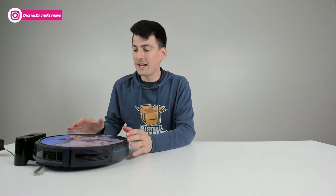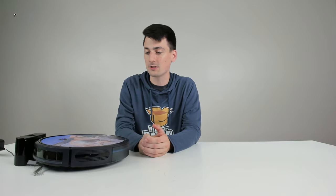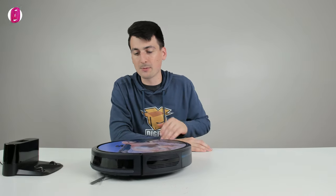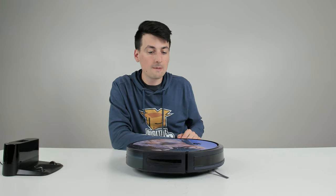When connecting to Alexa, you'll use the Smart Life skill to set everything up. If you authorize Smart Life and enter your credentials but it doesn't sync, go back and add it directly in the Smart Life app — that should solve any issues. Voice commands are simple: tell the vacuum to turn on or turn off. Hey Alexa, turn on R400 — and the vacuum turns on and begins cleanup. Hey Alexa, turn off R400 — and it shuts off. I've tried issuing commands to send it home to charge but haven't had luck; hopefully that'll be addressed in a future update.